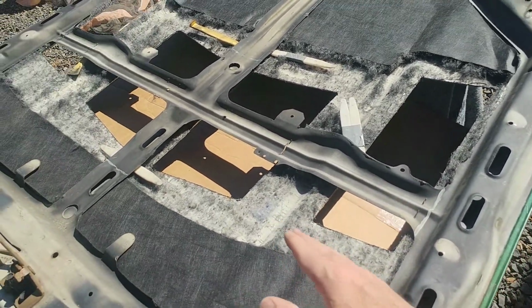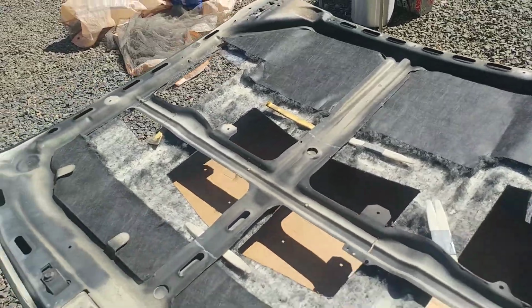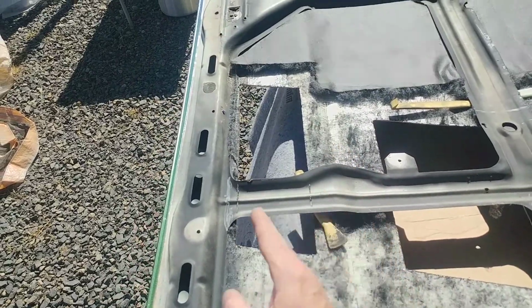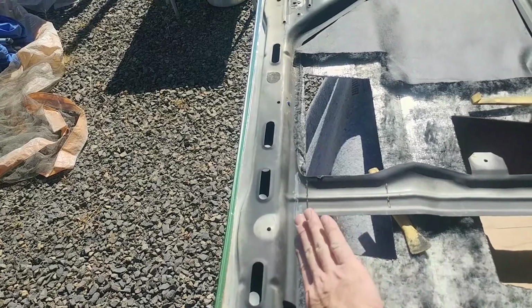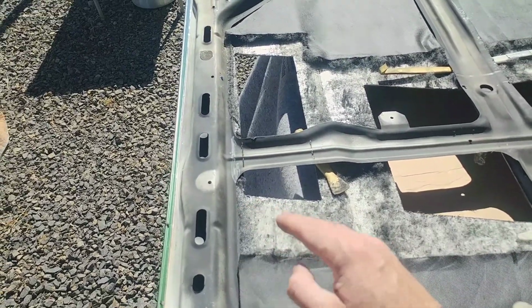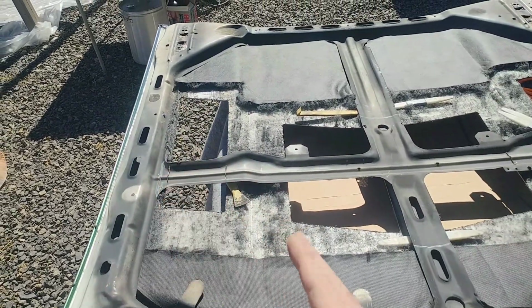There's nothing in the front to block, nor is there anything in the rear, and that goes for both sides. So you've just got a little bit on the inside to cut, a little bit on the outside. Again, I'm going to do right there in the radius, right where it comes up away from the hood. And then again, nothing on the front, nothing on the rear to cut for your sides. So go ahead and use a cutoff wheel there.